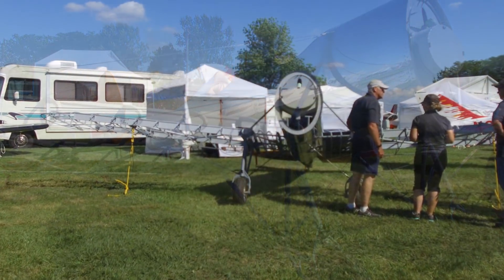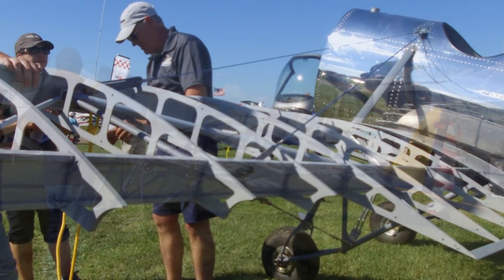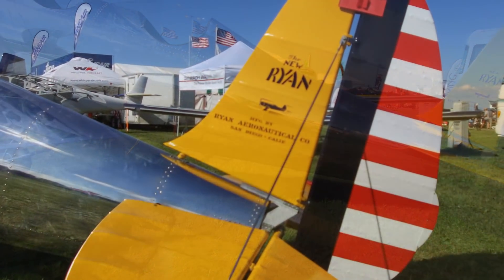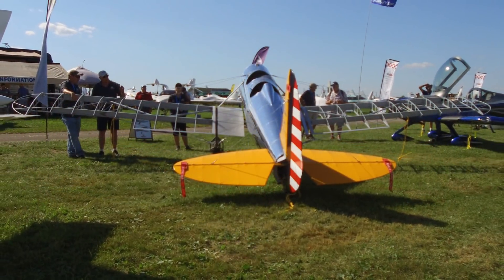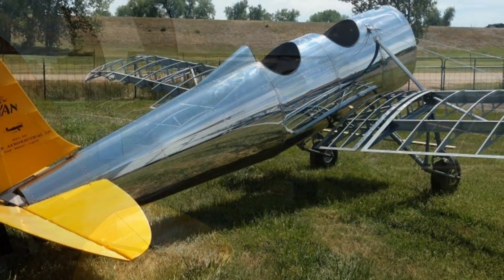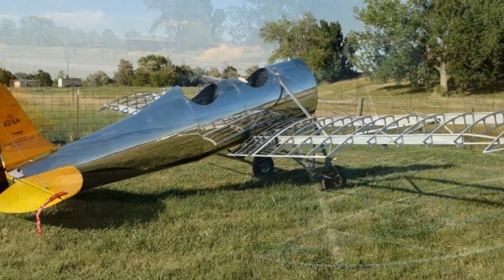It's a case of one thing leads to another. We get rid of the larger engines that had to power the original and get into modern engine options such as the Rotax or the D-motor six cylinders. You have modern engine options that weigh 100 pounds less. And so that small 5% on the structure takes up the rest of that 200 pounds. This airplane is non-aerobatic, and by reanalyzing it for a different limit load, we were able to chisel off even more weight.